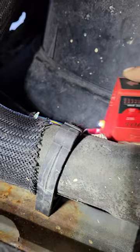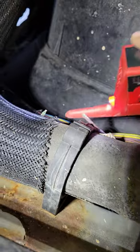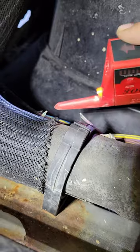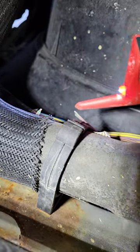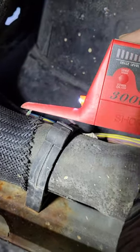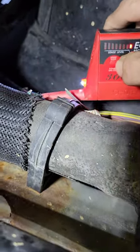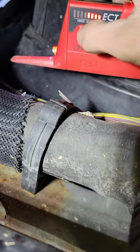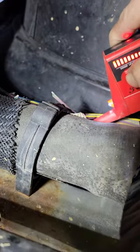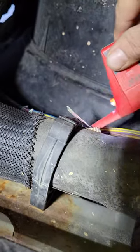I got it dialed in to one inch — that's how you're going to narrow it down closer. Boom, gone, got it, gone. That's how you get real close. When everything's still in the harness, that's tough to do. You've got to get this antenna and actually try to circle the whole harness. Turn it up if you're not sure — circle the whole harness, turn it up even more if you need to. I know my wire's not in the back, it's in the front.